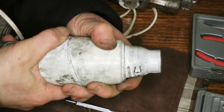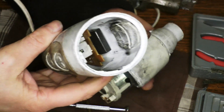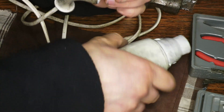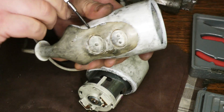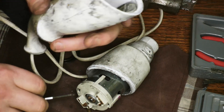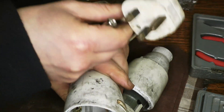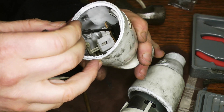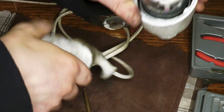Eventually these two halves sprang apart, which is rather good. I don't actually need to do anything to the back bit — if it's stayed intact, you can leave that as it is. If you do need to get into this part, you lever the rubbery plastic off, possibly starting here, and gradually this bit will just come off the other hard plastic. Inside here is a circuit board. Usual trick here: just check that you've got the plug to the unit in your hand before you start prodding the insides, otherwise you can get shocks.